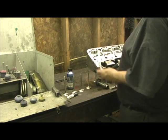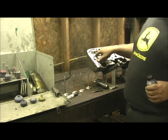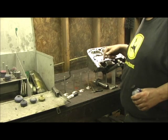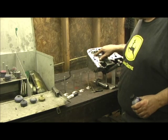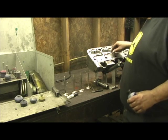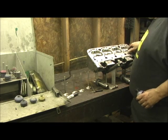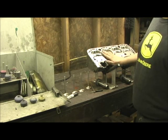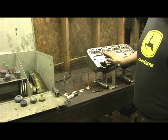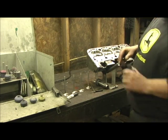The first thing we want to do is take our blue Dykem. By the way, this head has got hardened exhaust seats in it — somebody put them in there, and that's a good thing. So this head is probably going to be one of the top pairs of double-hump heads I've ever done. It just lacks a couple of little things from being picture-perfect, but it's pretty damn badass.